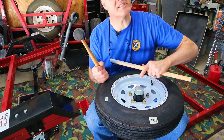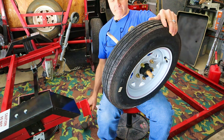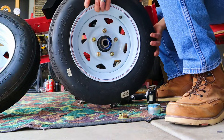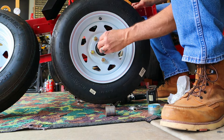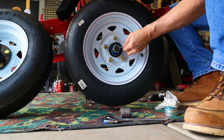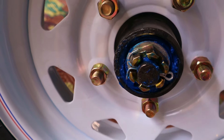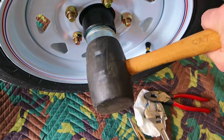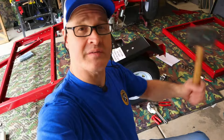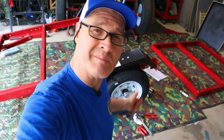To put the wheels on, you need to remove the dust caps using a wooden dowel rod and a rubber mallet — just tap it off. Be sure you don't dislodge the bearing or the seal on the back end. Slide the tire over the spindle, then the washer. Thread the castle nut onto the axle until the tire starts spinning with slight resistance, then back off slightly and line up the gaps in the castle nut with the holes in the axle. Insert the cotter pin and bend the pins in opposite directions to secure the tire. Replace the dust caps by tapping them with a rubber mallet. Don't forget to lubricate the Zerk fittings on the back of the hub assemblies with heavy bearing grease. The torque specs on the lug nuts are 85 to 90 foot-pounds — be sure to check them before you head out on the road.